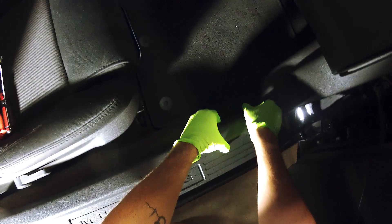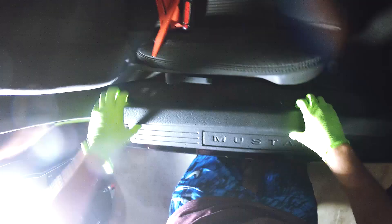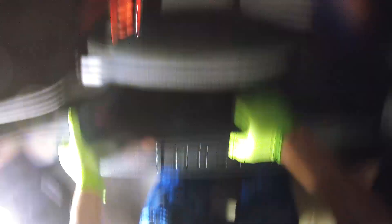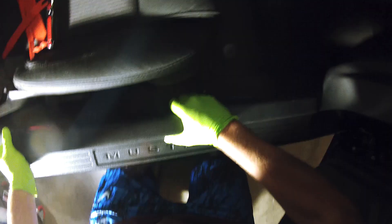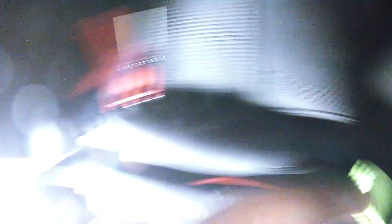Armed with a light, I have some interior trim panel removal tools. I heard this scuff panel is the biggest pain in the butt. According to the manual, you just lift up from each side with firm, even pressure and that's how it comes out. I don't want to brute force this thing — that side popped up. There we go, just pull straight up. Now I can access this area.